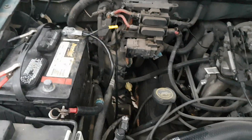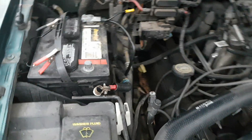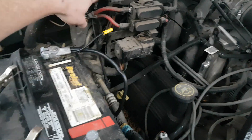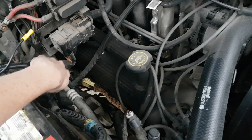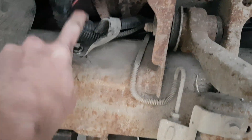Just got done replacing the negative battery cable. For people who have a Ford F-150 '97 or within a few years of that, they run a ground wire from this bolt to the battery, and then they run a heavy gauge four-gauge wire all the way down to the solenoid. From the solenoid it splits and goes to here — all these wires go inside.